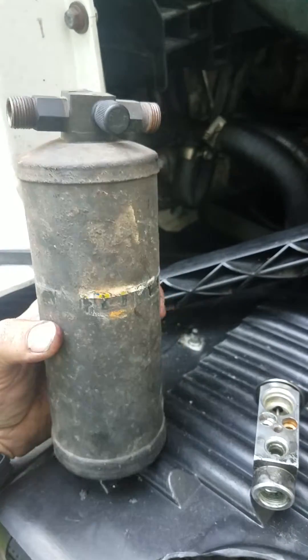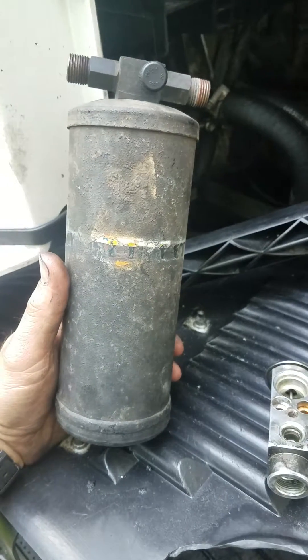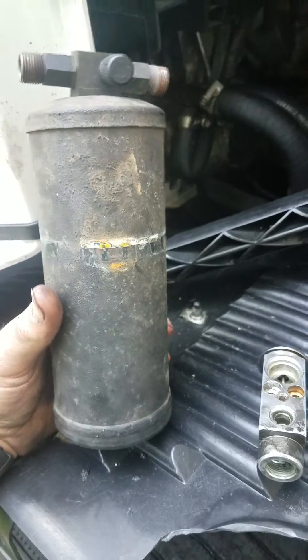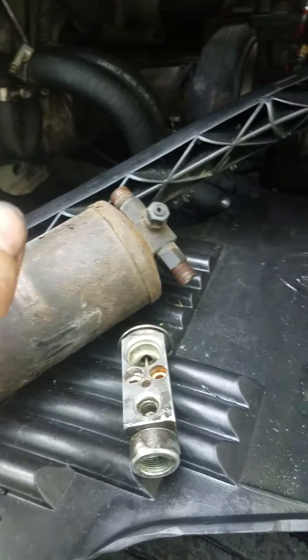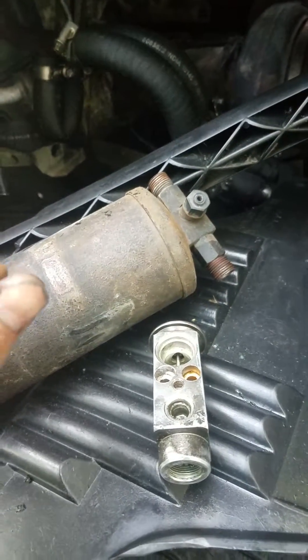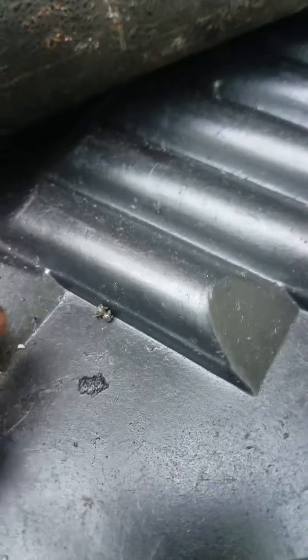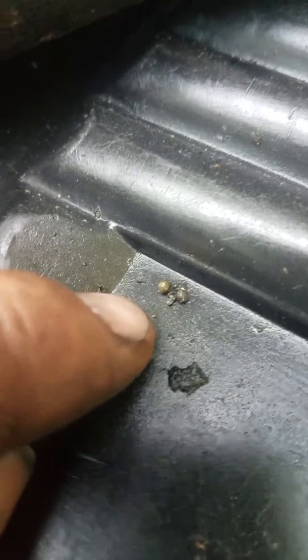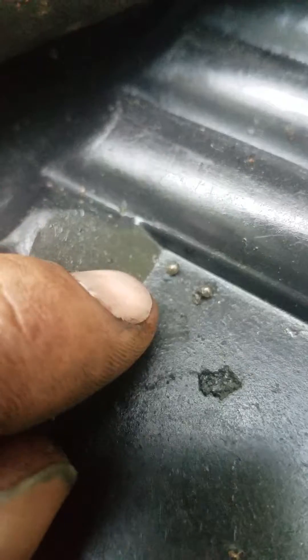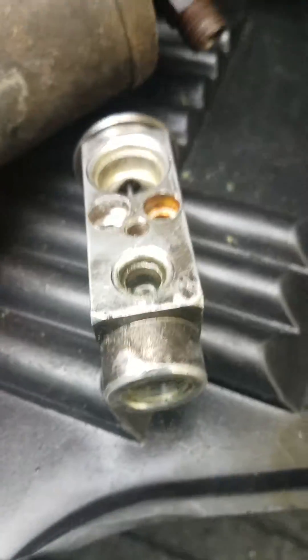Your dryer is on your firewall, and what it does is take out all the moisture from your AC lines. When they get old, they have these little BB-sized, ball-bearing-sized desiccant beads inside. Here's some right here — you can see them, these came out of the line. That's what they look like. They absorb the moisture somehow based on what they're made of.